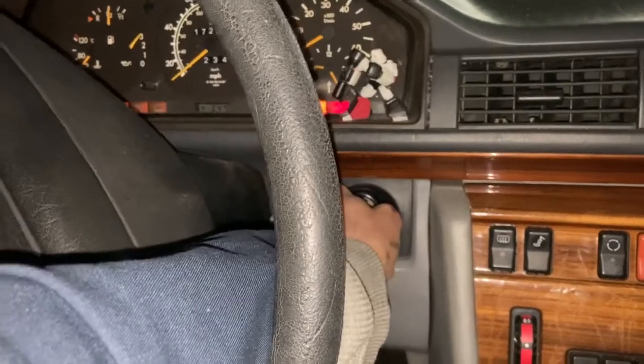I've got it going. Don't give it any gas — just let it start and cycle. My camera died, but I was saying: go check for leaks under the car, at the filter area, and by the drain plug. Also, you don't want to rev the engine when you first turn it on. You've just emptied the oil from the engine and it hasn't had a chance to cycle yet, so if you rev it you're revving an un-lubed engine and that's not good. Let it cycle, let it warm up, then you can drive around and rev it whatever you want.